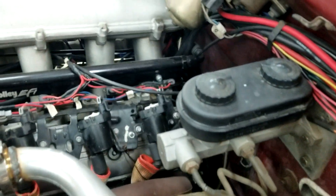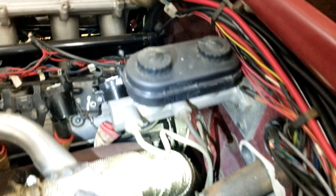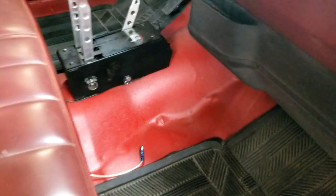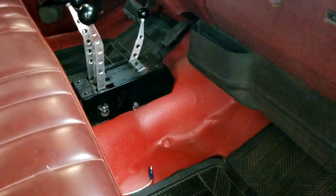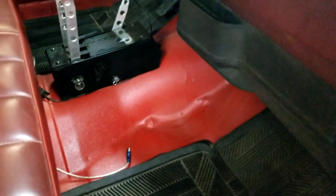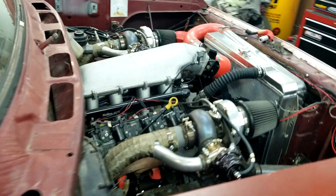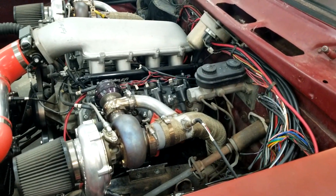There's plenty of room where we set this thing to get to the transmission bellhousing bolts, so you can pull the tranny separate from the engine. Only thing was this was a slant-6, not a 4-wheel-drive truck, so the trans tunnel is smaller than a 727-equipped truck or even a four-wheel-drive — so it took some dinging. That's where one of the trans cooler lines is. It's a '97-and-up, so it's got the front and back cooler lines. It is a little bit of massaging on the floor pan, but it did fit. Not much clearance with that big transmission in that small trans tunnel, but it works — no surgery, unlike doing an A518 into one of these.